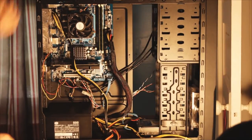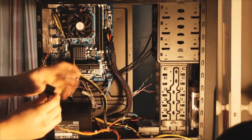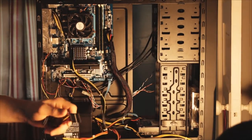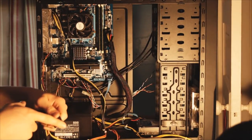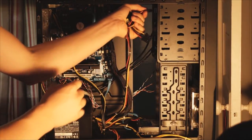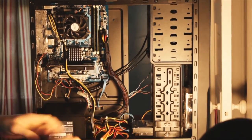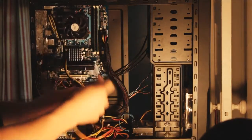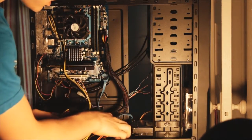You will have a DVD drive up here that's going to need one of these SATA power connectors, and there'll also be a blue SATA data cable that'll already be hooked up to it — you probably didn't unplug that earlier when you took the power supply out. Just take this SATA power connector and plug it in right up there to your DVD drive.